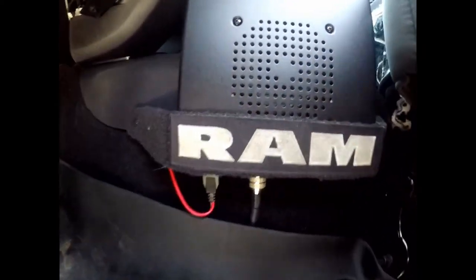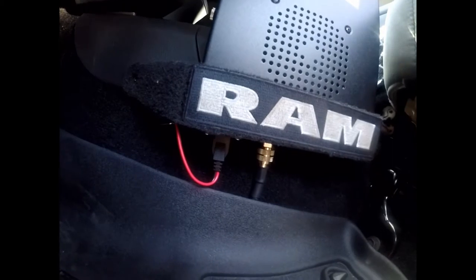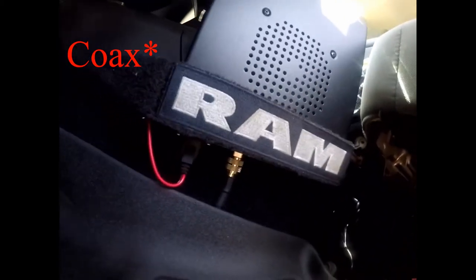The power cable and coax are routed through a grommet under a harness — there are about 20 wiring harnesses bundled and wrapped in tape under there. I took the grommet out, drilled a hole — drilled it a bit too big — then put black silicone over it. Once it dried I sprayed Flex Seal over it, which works okay. Black silicone isn't ideal but it worked, and I used it because I already had it.